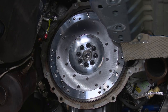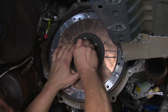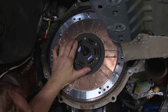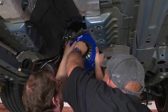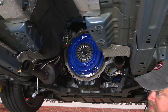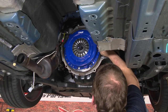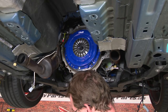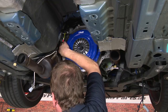Now we're ready to actually put the clutch into place. Put the input shaft alignment tool on the disc, and make sure you put the disc in the correct way — there is a trans side and a flywheel side. Once you have the disc up into place and seated, put the pressure plate up and bolt it down. When installing the clutch bolts, put a little dab of blue Loctite on there, because you want to make sure these stay tight. We're going to install all the clutch bolts that were included, which is actually more than the factory setup. Tighten them in a star pattern — we contacted SPEC and they said the torque spec is 47 foot pounds.